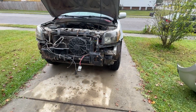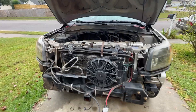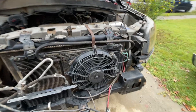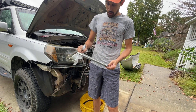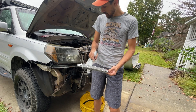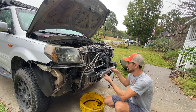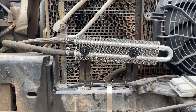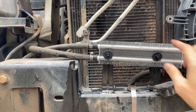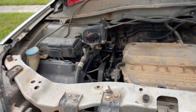Unfortunately, my Pilot's weakness is gearing, so when we're doing steep climbs the transmission temperature can climb and I have to be really aggressive. These are actually two Hayden transmission coolers right there. The new power steering cooler I bought is a lot more simple, and except for the fittings, it looks like it has a lot thicker tubing going throughout it. So I'm hoping that alleviates some pressure. I've got to figure out how I'm going to mount it, but it's on there plenty firm enough, and I'm hoping this has less restriction on the power steering and alleviates any future leakage from these power steering hoses.